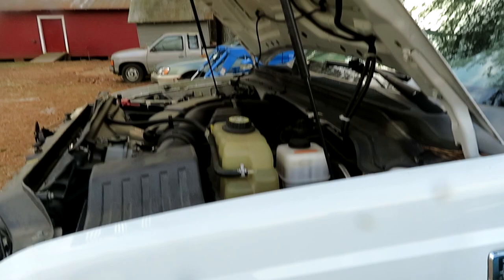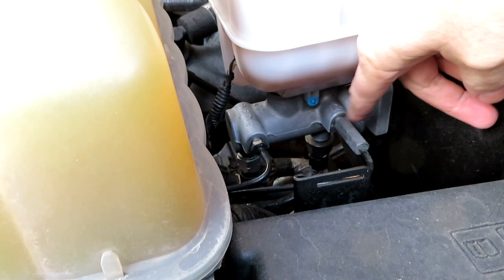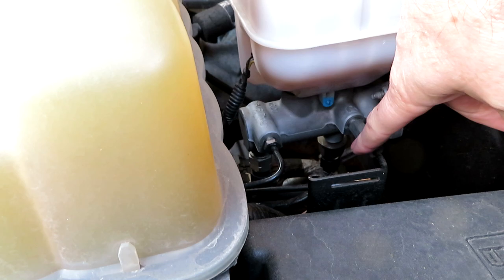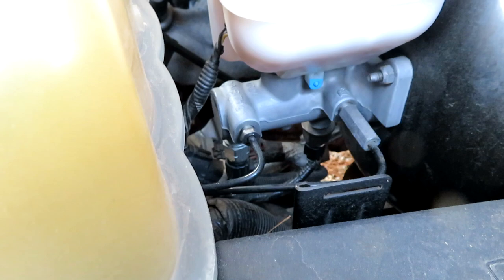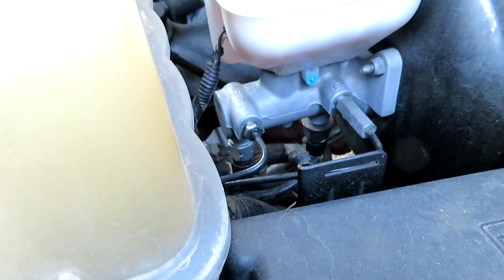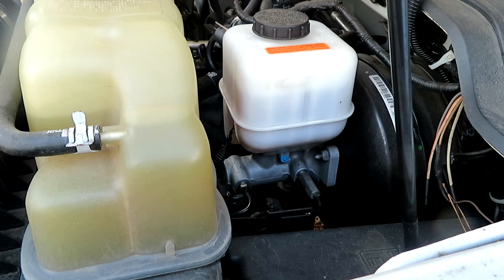Here's under the hood — the Super Duty master brake cylinder. Right under here you can see there are two plugs now plugged in. One is for the pressure switch for the trailer brake controller. The wiring harness was originally in here, just taped up alongside the side of the truck. All I did was pop out the old master brake cylinder and pop in the new one with the second connector, so everything should be hooked up electrically now.